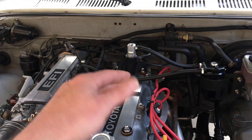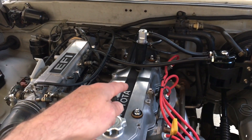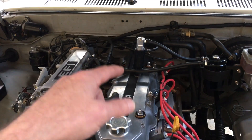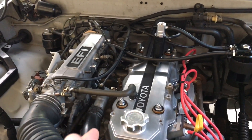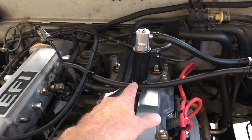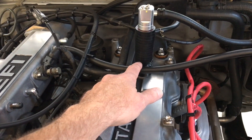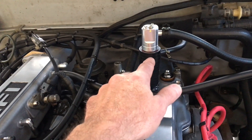The oil might still pool back there, but because of the baffle design being forward of the very rear of the roof of the valve cover, and also having that little hole in the front of the baffle — you'll have to go back and look at the previous video, I'll link it in the description — I think that front little hole is really helping when going uphill or downhill. Everything I've explained was with just this external baffle, which is a throwback to last year — a one-inch silicone hose, perfectly empty except for the little funnel tip thing I fabricated.